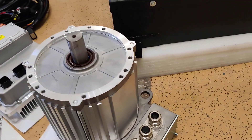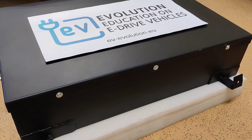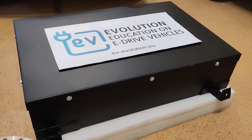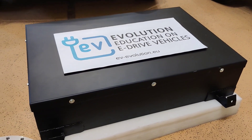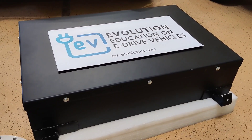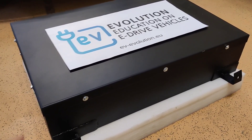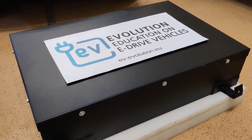This is our battery — a LFP 96-volt system. Lithium iron phosphate battery is the most secure battery on the market, with roughly double the life cycle compared to standard lithium-ion, and a more stable, flat voltage curve so there is no performance drop while driving. It already has mounting positions pre-made for the Fiat 500. LFP batteries are the safest batteries currently available, and the 96-volt system is very powerful for a small Fiat 500.